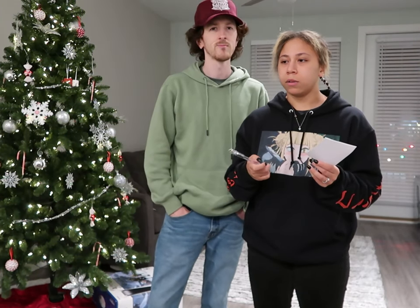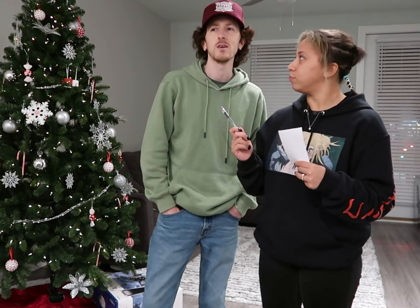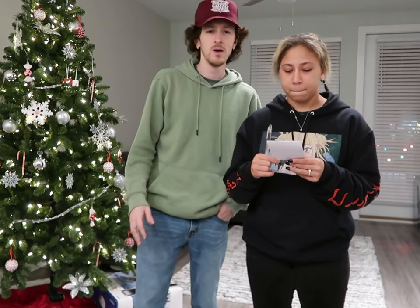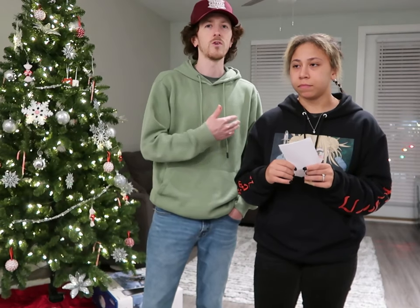Right. Now, the total mileage, I'm gonna let him explain this one because it's kind of weird the way that it works. So the scooter has 18 miles max range, and you're only gonna achieve that 18 miles if you're in, I guess they call it the eco mode, where you're going about 12 to 15 miles per hour. With going full speed the whole time, you're only gonna get about 10 miles on a single charge, nowhere near the 18. And with us together riding on it, it's about 8 miles. So not much difference with that added weight.